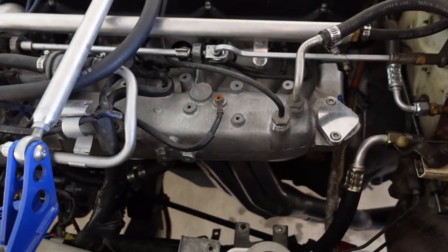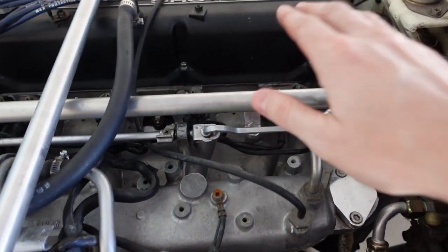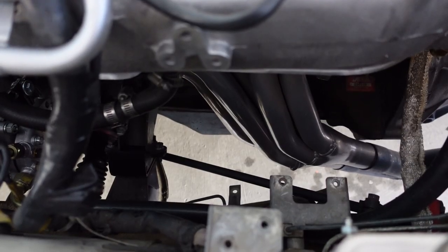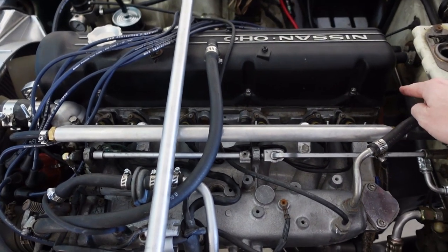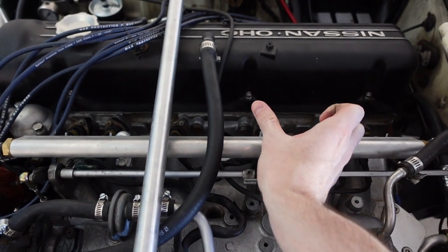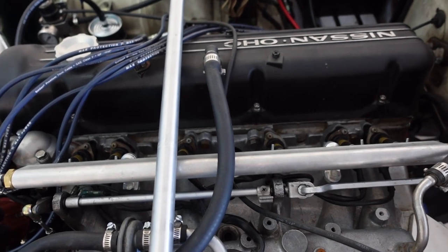A couple notes for installing the header: it's a huge pain in the butt because you have to take off the intake, take that off, take the fuel rail off, and then finally you have access to the header. We had to take this off because we had a bunch of exhaust leaks, and that's because we tightened the bolts for the header from the outside inward. What you're supposed to do is tighten the inside bolts first, get it nice and flat up against the head, and then tighten to the outside.